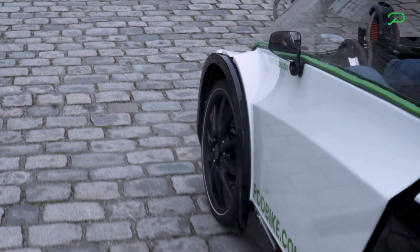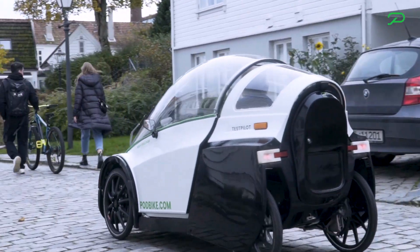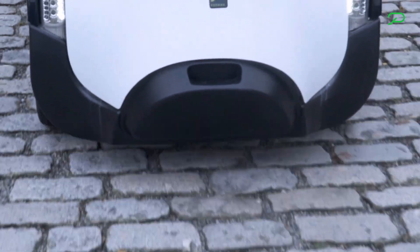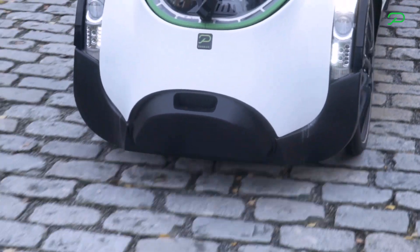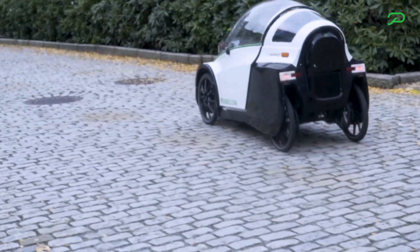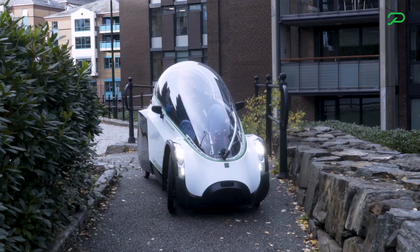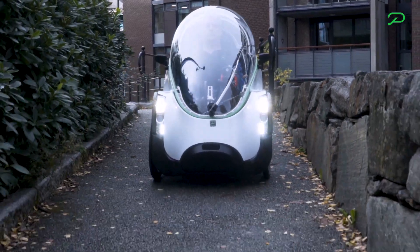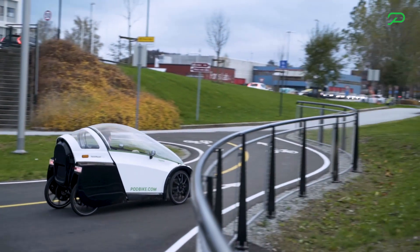Bumpy road works quite well. The wheel suspension in the rear is similar to a standard trailing arm suspension on cars, but it's fully independent, so it's quite comfortable to ride. The front suspension is a multi-link suspension, which also has fully independent movement, so you're kind of floating on bumpy roads. That said, it is not an off-road vehicle. An off-road version will be available as a conversion kit, so you can take the existing Frikarr and convert it into an off-road.